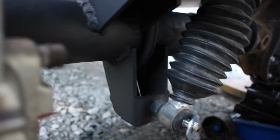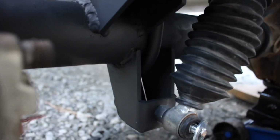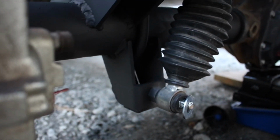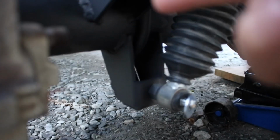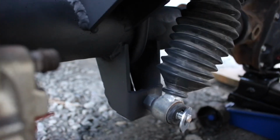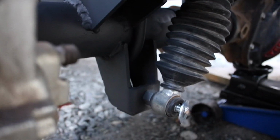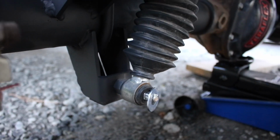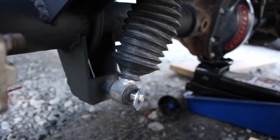And then we set the shock mounts. These are the Barnes 4-wheel drive shock mounts for axle swapping for XJs. They're the same structure as the original OEM ones. We took a measurement on those from where they were off the perch up there, and then we measured off of that and got the exact measurement. We set the same angle as the perch plate, so that way it was centered and everything was level. So that's how we did that.